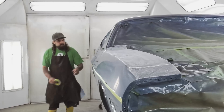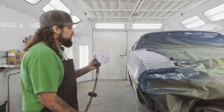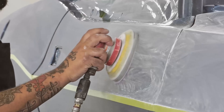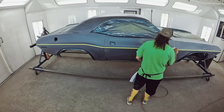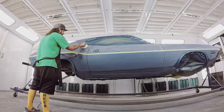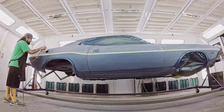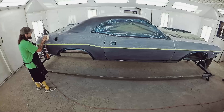It takes a little bit more time than some of the other cars, but the end result's the same. I mask off all the edges just because I don't want to burn it. Because once you burn it, sometimes it can be challenging trying to fix it. I just would rather be safe than sorry — make sure those edges are all protected. If you catch the edge when you're sanding or with the buffer, if you don't have those edges protected, you burn it. That means you actually sand off the three or four coats of clear coat, the however many coats of color you have on there, and you can go right down to the primer — literally an inch or two long, all the way down to primer. That's why I just put the tape down to make sure I don't have any problems at all.